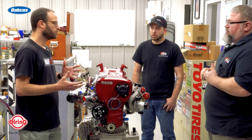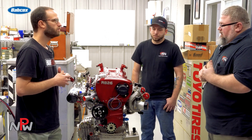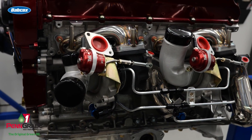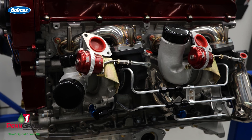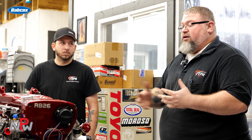He should expect 750 to 800 horsepower, and it's turbocharged — how much boost do you think he's got to run? If he runs on pump gas, I'd probably say he can run about 18 pounds and that'll put him in the 500 horsepower range or so. If he puts a little race gas in there or runs E85, he could certainly hit those numbers. 30 pounds of boost on this with the right tune and the right fuel — no problem at all.